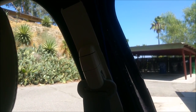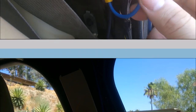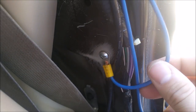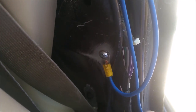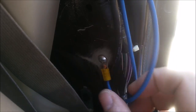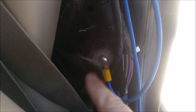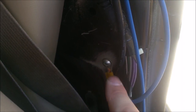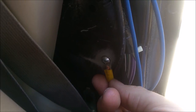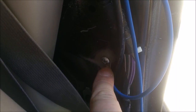I just have to run three wires. I decided not to wire into the doors because the lights are only three inches away from my door lights anyway — it's not replacing them. I'm using all the same color wire just because I have a bunch of it — it's a lot easier if you don't. So I'm wiring stuff in as I go just so I don't get the wires confused. This is the ground — it just has to go to anywhere metal on the car.